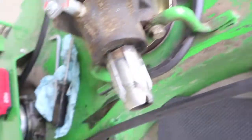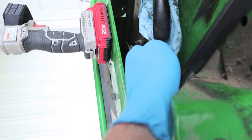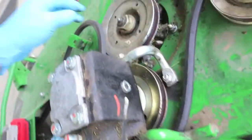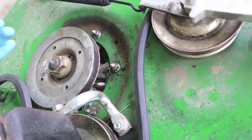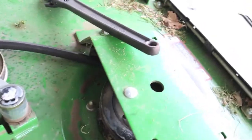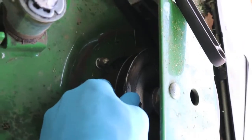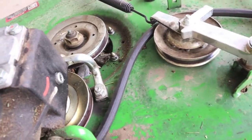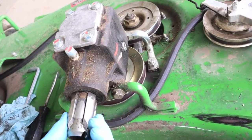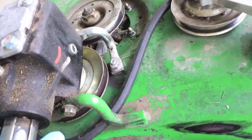After loosening the belt, you can reach in and take the pulley — the individual blades are turning nice and smooth, no play in that pulley. The middle one: lift the belt up, no play, very solid with just a minimal amount of drag. Same with this one — no movement whatsoever. I was shocked when I got to the gearbox. I turned it last — now listen to this — you can see a little wobble in that pulley.